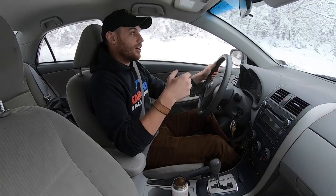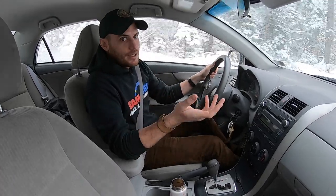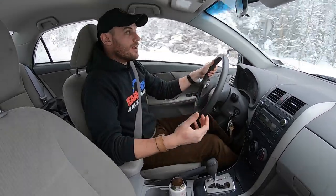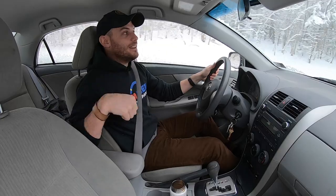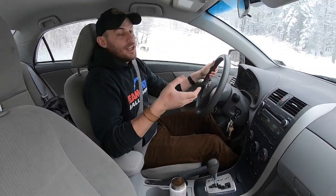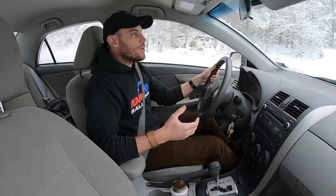To address the first few comments likely to pop up: does it work in all different vehicles, and is it hard on your vehicle? In a front wheel drive car, it's easy on equipment — you're never really going to damage anything. In a rear wheel drive car, you're going to want to be on the brakes with the clutch in, otherwise you risk locking the rear brakes up in gear which will stall the motor. In an all wheel drive car, you only really want to do it when you really need to stop quickly — in emergency situations. You can practice it, just don't use it a ton because it will be hard on the center differential.